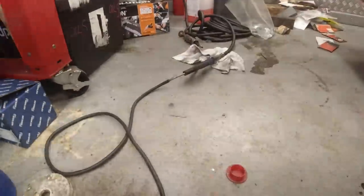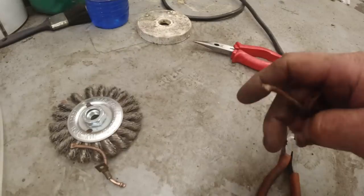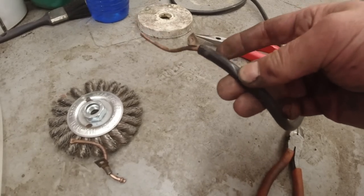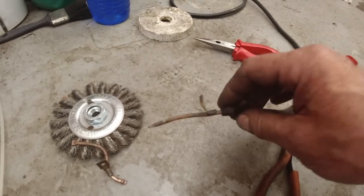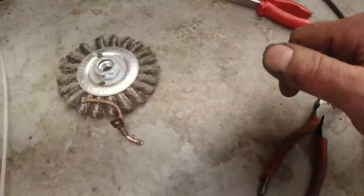Can you see it? Luckily, the air lance has a slight leak, so it's handy. If you put too much power on it, it'll blow the pipe off, blow the tube off. This is not high pressure rated. If you blocked it, it'd actually balloon. If you cable tied it or Jubilee clipped this on and then hit full pressure and this was blocked, it'd probably blow the pipe. But anyway, there's another way you can test them as well.